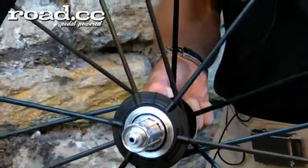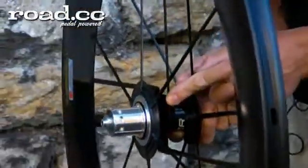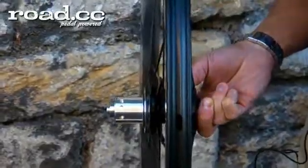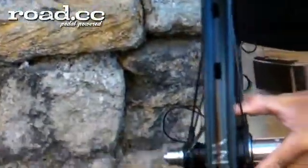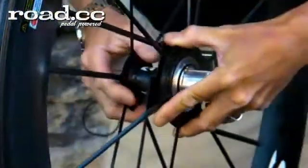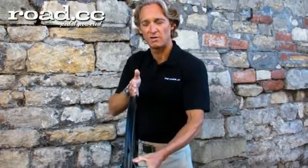They not only transfer torque in the same way that crossing metal spokes transfer torque, but they do this in a more efficient manner because the third flange — the middle flange, also known as the torque flange — is placed directly in line with the center of the rim. As torque is applied, the wheel is pulled in a direction in the same plane as the center of the rim. Unlike crossing spokes that pull the wheel to the left or the right, to the plane of the left or right hub, the center flange keeps the wheel straight as it's aligned with the center of the rim.